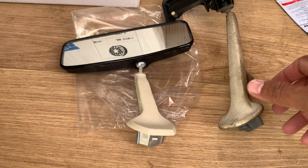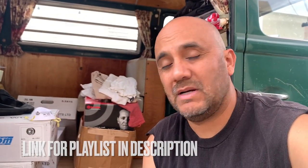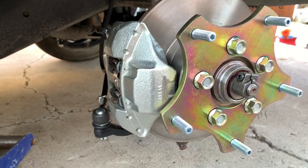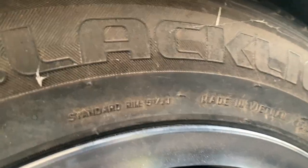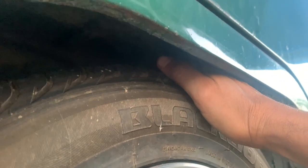I've been working on my suspension — lowered the front end and the rear, and also upgraded the front to disc brakes. I figured out my stance, but originally went down a little too low and didn't have enough clearance on my front tires. They would have rubbed; there was like an inch of clearance, so as soon as somebody sits in the car, especially two people, it was basically just going to rub.